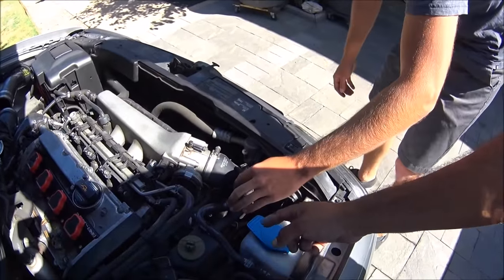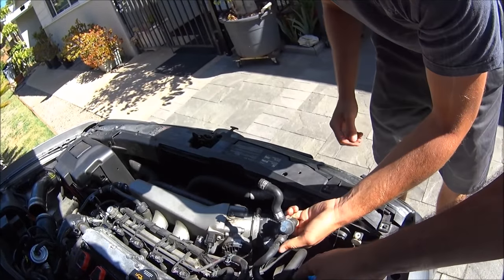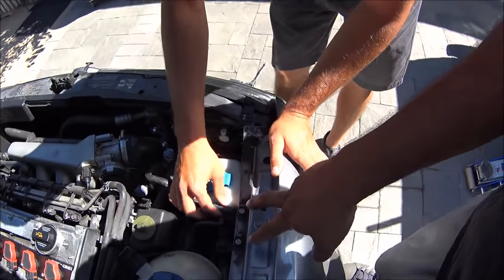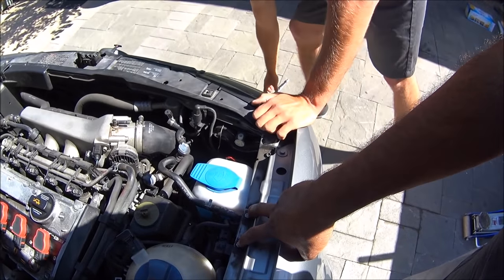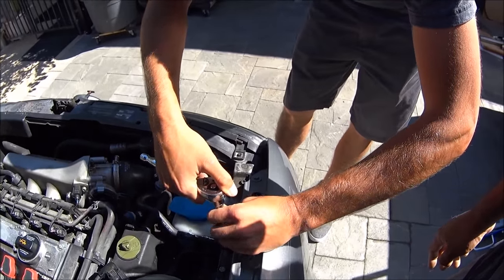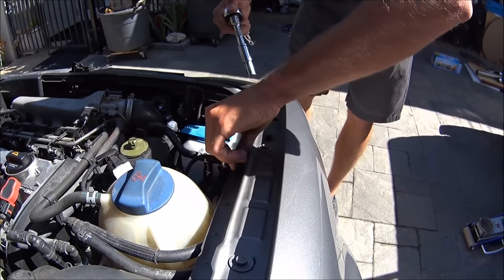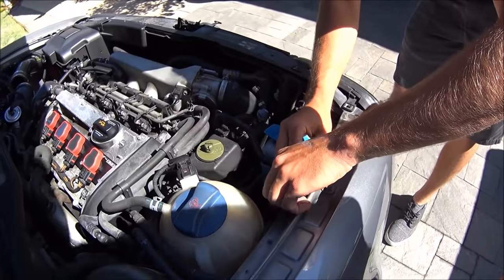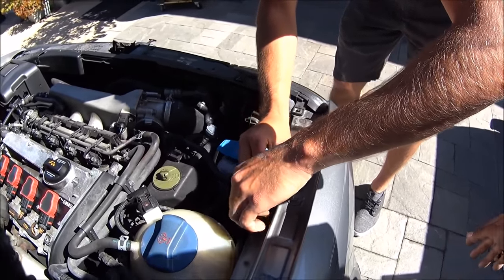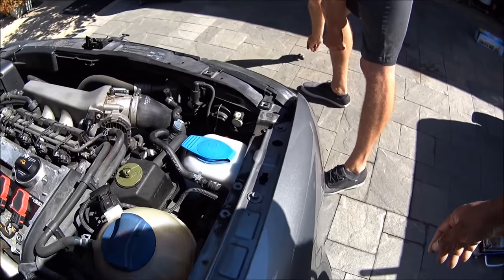Next part is on the left side of the motor — we're going to be taking out the vacuum lines for the smog system here. Pretty much the one on top of the throttle body, just yank it out. The one underneath it — you'll see this little spaghetti one, follow it and just yank it out. There are two 10mm bolts here you're going to want to take off next. Now you can do this with the car's battery in place — it doesn't matter if the battery is in or not. It won't throw any codes, but it will throw a code for the secondary flow. So if you don't have a tune yet to tune it out, that's probably going to be your next part of this process.